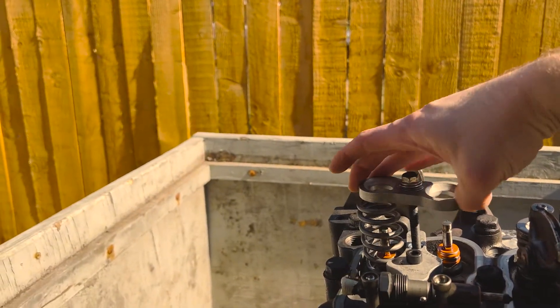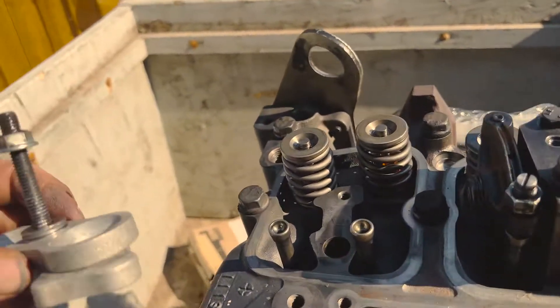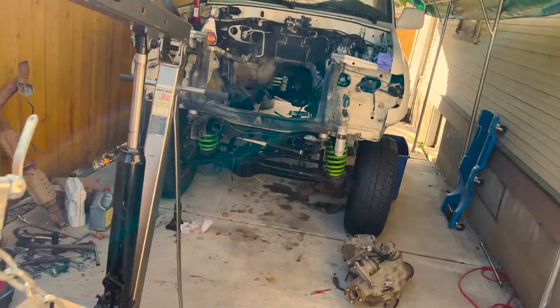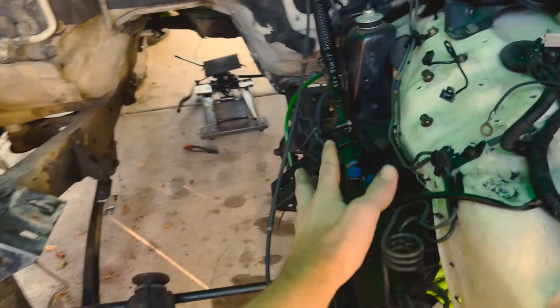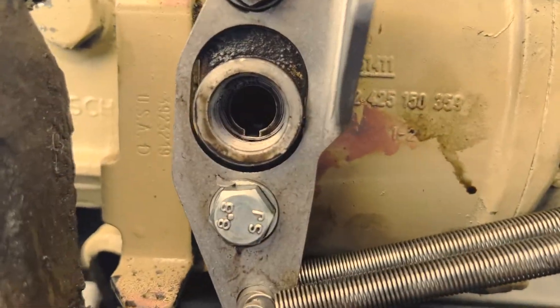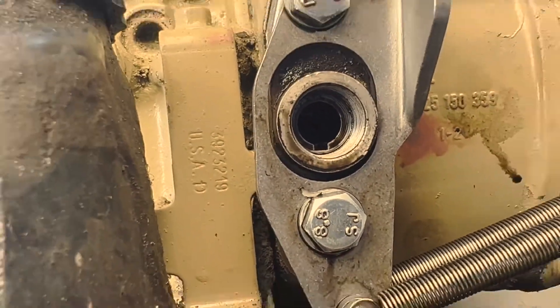Those are noticeably taller — there you have the Power Driven Diesel in-chassis valve spring compressor with the 60-pound valve spring installed. Now we're getting very close to putting the engine back in the truck. Because of the limited area near the firewall with the p-pump, I want to make sure it's timed correctly. We can see up in there — that little tooth is the flag indicating the p-pump is timed for top dead center.